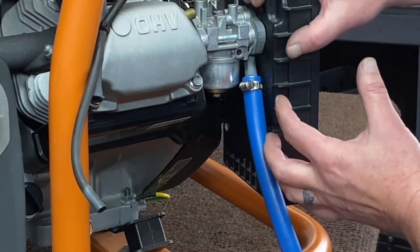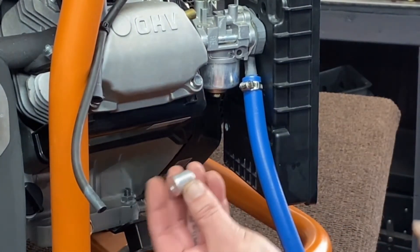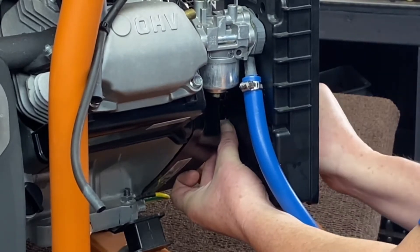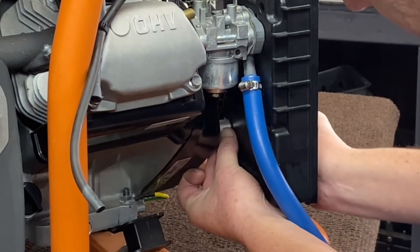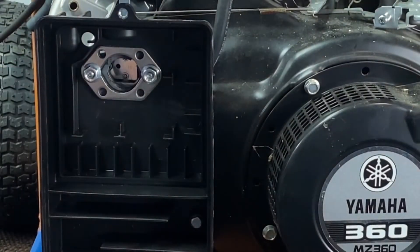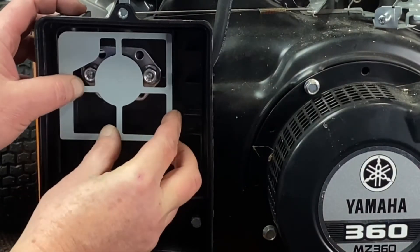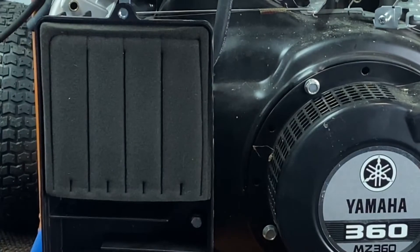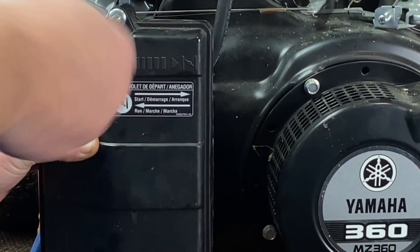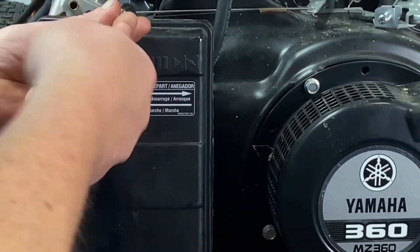When we install the slim adapter, obviously this pulls the unit out. So on the back side where your bolt went through for your vibration on your bracket, we'll supply you a spacer — go ahead and slide that in and get your nut back in on the front and lock that down. Make sure all that's locked down, got our vibration bracket back on. Go ahead and put our bracket back up in there, get our filter back in, and get our air cleaner cover back on. That step is as easy as that — everything fits on there good.